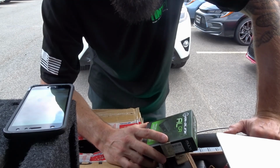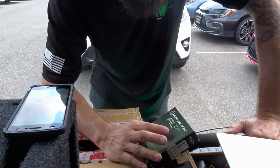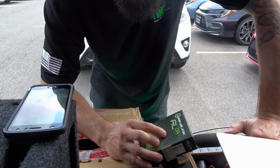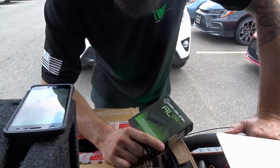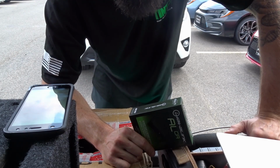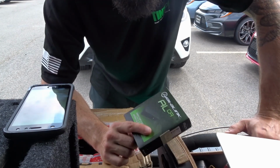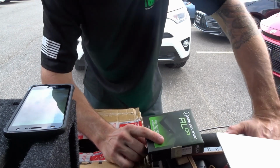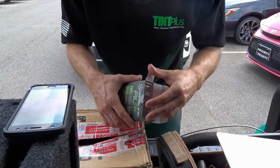If the customer wanted to add longer range remotes, you can use a part from CompuStar, and I think FlashLogic makes one as well. But the CompuStar part number is FT-D100, and that is a decoder for the remotes. Some of the higher end remotes have the decoder built into the antenna, but a lot of the single button remotes don't, so you need that extra part. Anyway, I'm going to use the ALCA and I'll flash it and go over the wires.